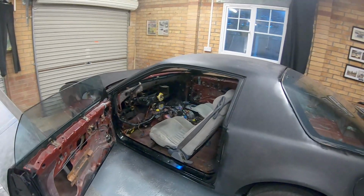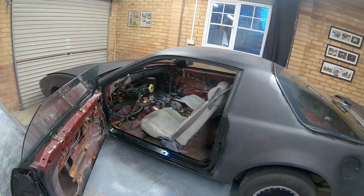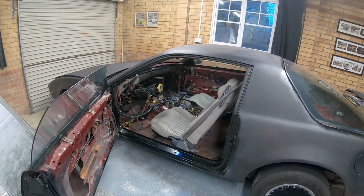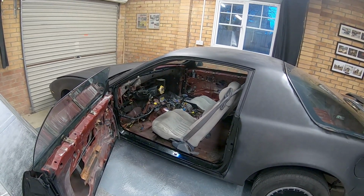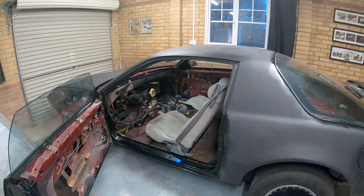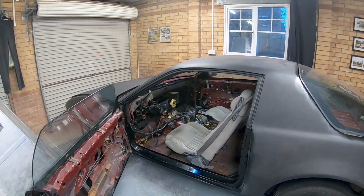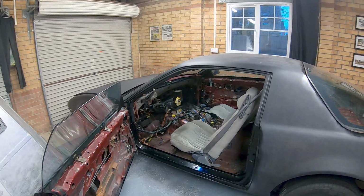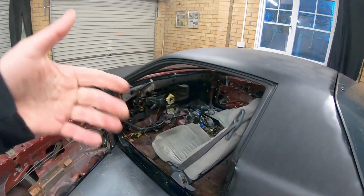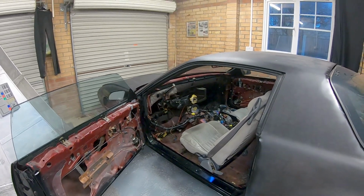is just like the foundation of the car that I explained at the start of the video, like all the mechanical side of things, the suspension, all of that, you need to make sure the inside of your car is very sound. When it comes to the electrics, you need to make sure everything is checked, everything is fused, everything is run correctly. There are no perishes, no cuts, no holes, no breakages in any of the cables and the wires. The only way to do this is by going over everything in the inside of the car and checking it manually. That's the only way to do it.